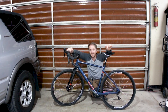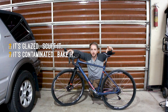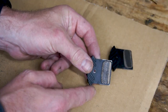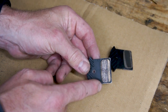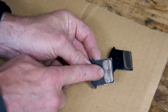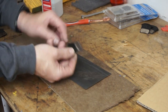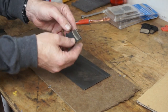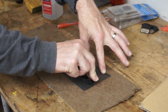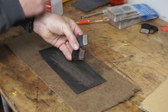If you've made it this far and your brakes still squeal, I want to talk about those other two items on the list. First, I want to show you how to deglaze your pads and rotors. This shiny surface you see on this pad — this pad is glazed. What has happened is it's gotten hot, and the combination of heat and friction has polished the pad surface, and because it's shiny like this, it can cause it to squeal. The way to remove that shine is to use some 600-grit wet-or-dry sandpaper. I take the pad and drag it along the sandpaper, effectively sanding off that shiny surface. It only takes a couple of passes to knock the shine off, and then after sanding, we'll want to clean them up really well with more alcohol.